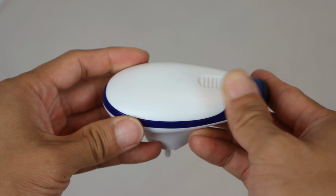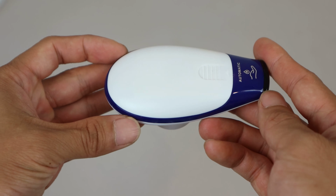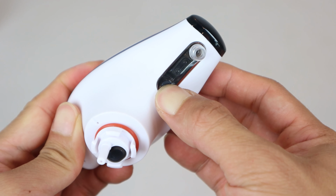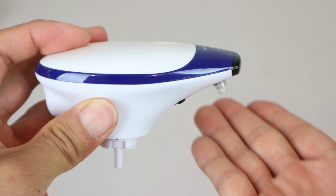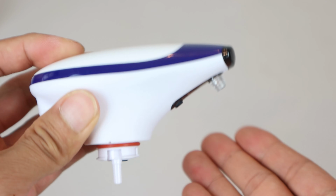While I would have preferred something rechargeable, the batteries are supposed to last 6 months to over a year, depending on how often you use the machine. To turn the unit on and off, press and hold the power button for 3 seconds, until the orange LED in the tip flashes. Now, when the unit detects an object under the nozzle from 2.5 inches away or less, the motor will run to draw in the contents of the bottle and dispense a predetermined amount.